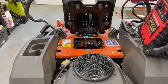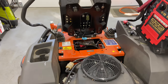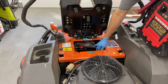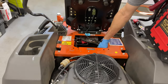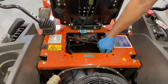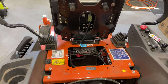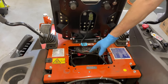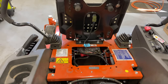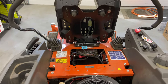What we're going to do now is install a battery. We know this is definitely a dead battery. They don't make it easy to get into the battery box at all. Now they have these emergency brake handle safety switch mechanisms here that I'm not real happy about. We're going to go ahead and swap this out. This is a two-part video, and I'm going to tell you a tip — people buy the incorrect batteries, believe it or not. You think it's simple, but you've got a 50-50 chance of getting the right one.